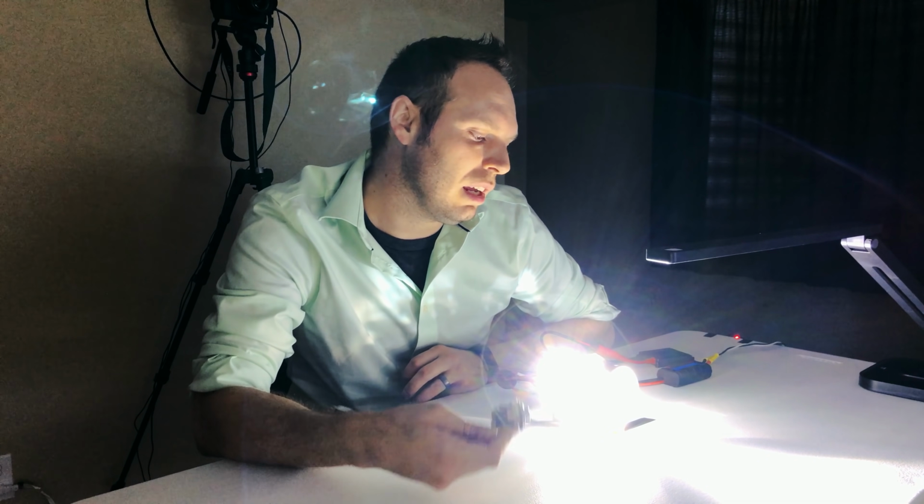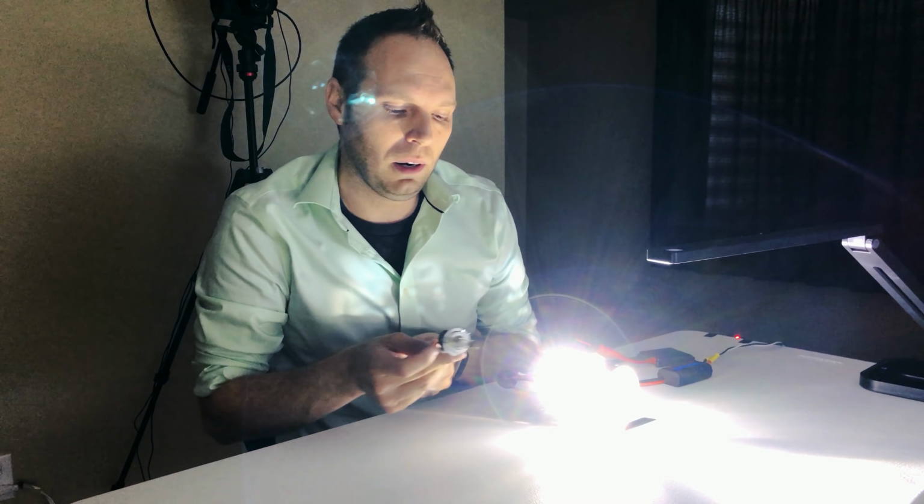We tested a ton of LED kits from Amazon, and we found good ones that actually don't produce any glare or very minimal glare. I would highly recommend LED in a reflector over HID. But if you got projectors, HID is the way to go all the way. HID is still king over LED. LED is coming a long way, but HID is just amazing for headlight output.